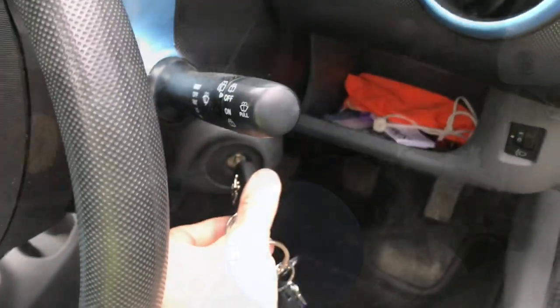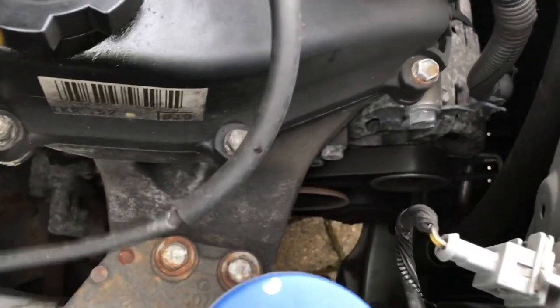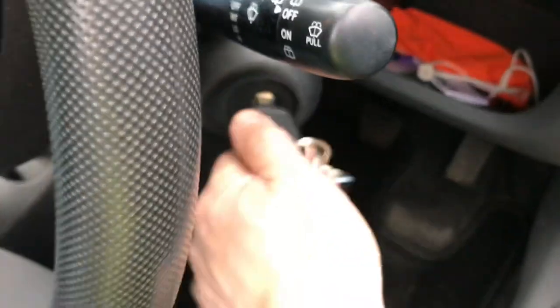So had a good look at it to see what's going on. I've checked the alternator belt and it's not loose by any means — it's got a bit of tension there — but I think it can just go up a little bit more, and that's where this noise is coming from.